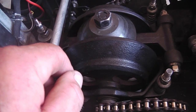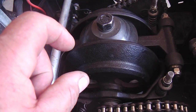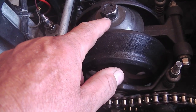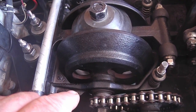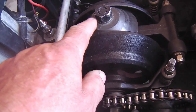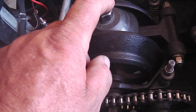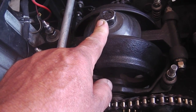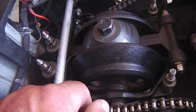You don't have to. If you've got that bottom pulley with enough collar hanging off of it, you can grab onto that to drive these lock nuts down exactly where you want them on the thread. But some pulleys down there may not give you much shoulder to grab onto. So to me, this is just what I wanted to do and get the most amount of non-threaded shaft down below, and having it right on the end of that shaft is the way to do it, for me especially. It was just a no-brainer.